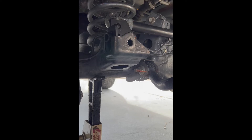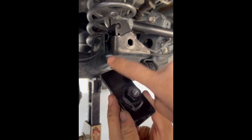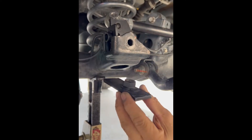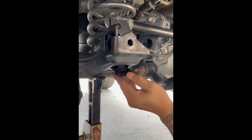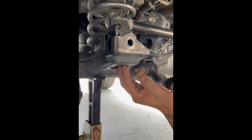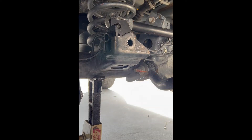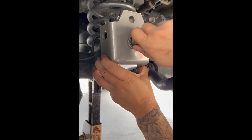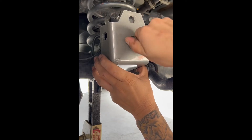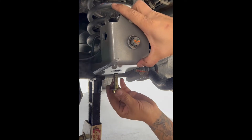We've got a wing nut with a welded nut on the plate — there's a longer end and a shorter end, and the nut faces up. The longer end gets slipped in first, going towards the front of the vehicle, then up and back. Center it as best you can, then get the front half bracket and feed in the main factory bolt — about five or six turns in, then fish for the bottom hole.